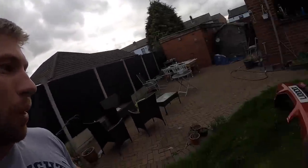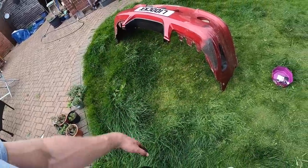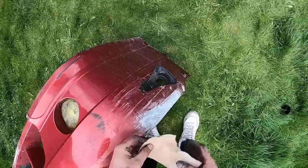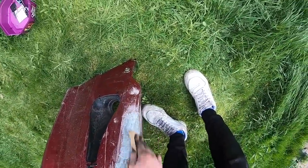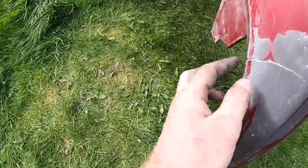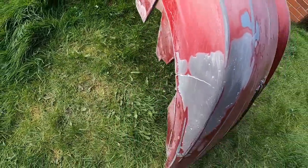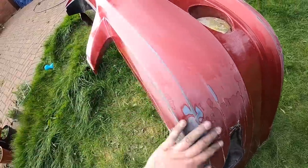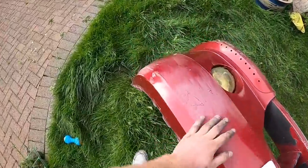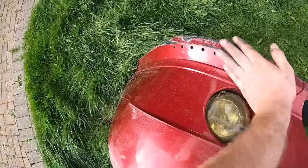It does feel a lot better. We just went and put the wheels on the car, they actually look alright to be fair. We've got the bumper here, this is dried, so we're just going to start flattening this down. We've got a block sand and some 80 grit. Let's start flattening that down, hopefully we can get it smooth. 40 grit, just to get the big lumps off. This is where I'm at — it still needs a bit more. Unfortunately one of the cracks at the top has failed, but the main one here is fine and that sits under the headlights.